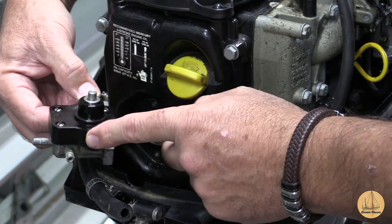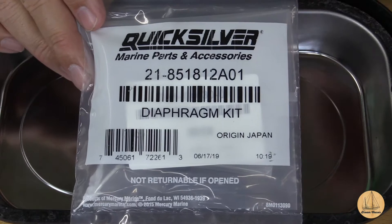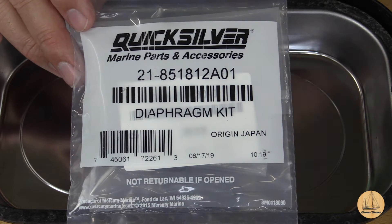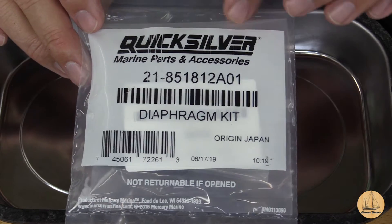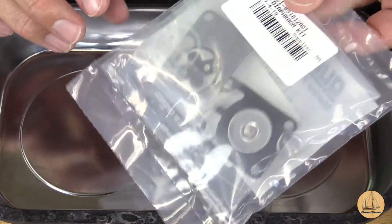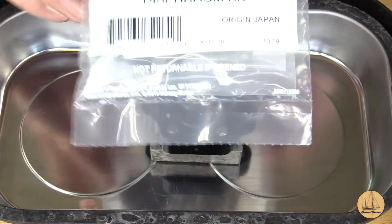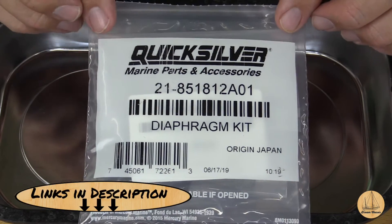As the lobe continues to push, this is essentially a small manual diaphragm pump. So we are going to open this up and rebuild the diaphragm pump. The first thing you need for a rebuild kit is to look up your actual manufacturer's part number or call your dealer - make sure you get the right one. This is a diaphragm kit for a fuel pump. This happens to be Quicksilver, which is just the retail brand of Mercury - it's still a Mercury part. We have a diaphragm, a couple of gaskets, and flappers. These parts were $63 plus tax.